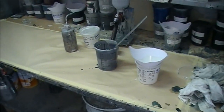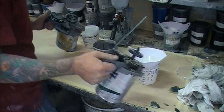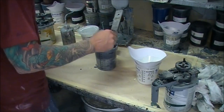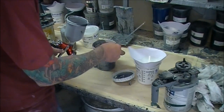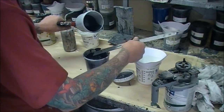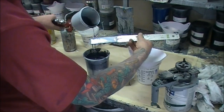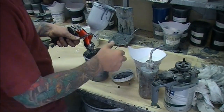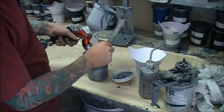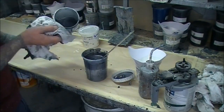I'll come back out and start slowly putting a little bit of the color in. Take it easy at the start when you're colour matching — just small amounts, then test how much that's done by spraying it out again, and add more if need be. I didn't end up putting enough of this color in. You can look at it on the stick and say, okay, that's done that, maybe I'll need to put a touch more in. Or you can flush it through the gun now with a bit of thinners to get the old paint out.